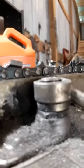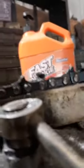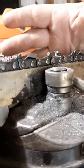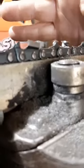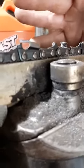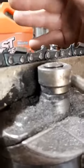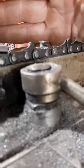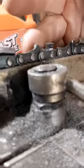We'll look and see if we can get this beautiful. You can already see no shadow line. And if you look at the top, you see no shadow line right there? I know you can see it. You shouldn't be able to see any shadow line on the top, because that shadow is just where that tooth is super thin, as thin as a razor blade. A razor blade's super sharp, don't get me wrong, but it ain't going to last too long. It ain't the same as a plane.